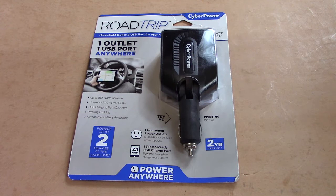If you'll remember the video I did about converting your car or vehicle into a generator, that was the very reason why you didn't use the cigarette plug on that particular converter — it was capable of drawing far more power than the cigarette lighter is able to produce. That particular inverter was capable of pulling 610 watts from the battery, which you can convert into AC power to power some items around your house. Once you exceeded around 150 to 160 watts, it would have blown the fuse in your car.